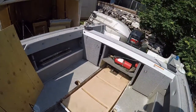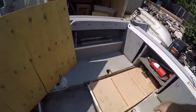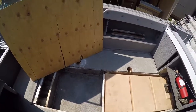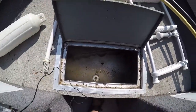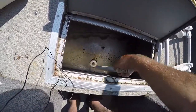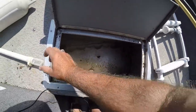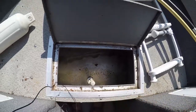I cleaned it all out, washed it, and vacuumed it. Once I have the cross members back on, the marine plywood also has an access panel for storage. This is my live well. For those of you who don't know how to drain it if you don't have the owner's manual — just pull this out and the water goes down the tube and out of the boat. There's a fill tube inside that puts water in, and once it reaches the top, a sensor shuts it off.